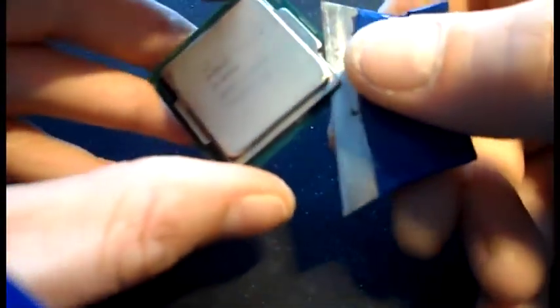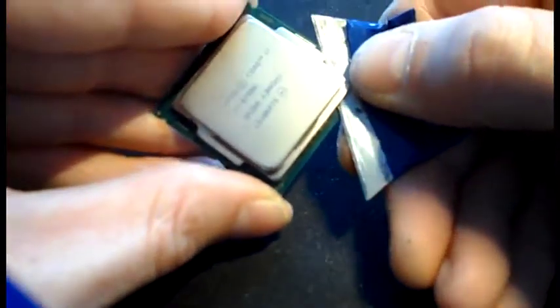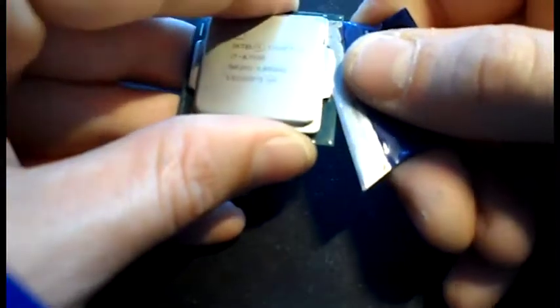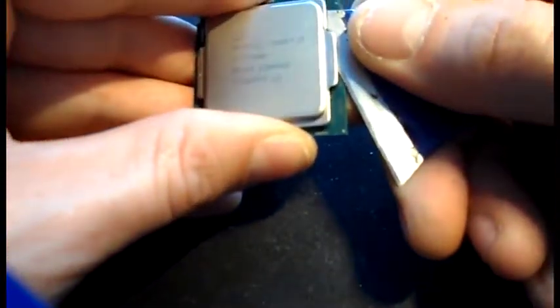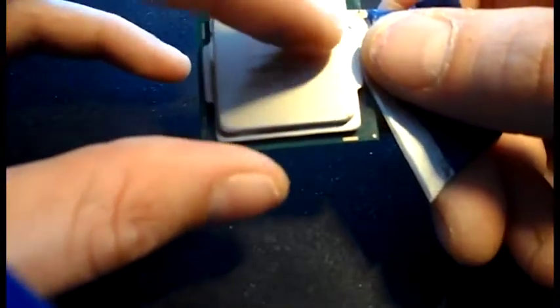Sorry I keep going out of focus - I had to use a makeshift tripod. My camera is currently attached to an old hard drive with electrical tape to get this angle. This last side is just being a little bit of a pain - just keep working it from both sides. I can feel the internal heat spreader just loosening up all across this side. That could have ended badly - I was pushing towards the metal part of the processor, which is exactly why I angle it that way, so if I slip I'm not going through the chip.